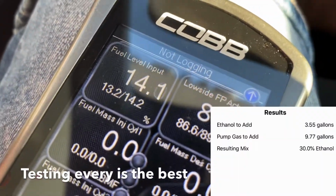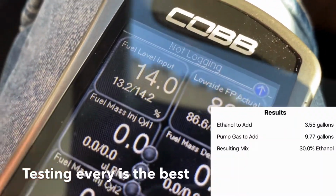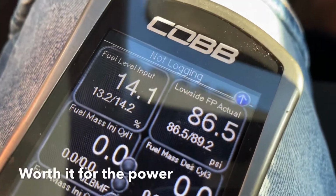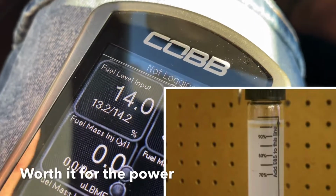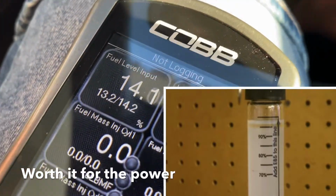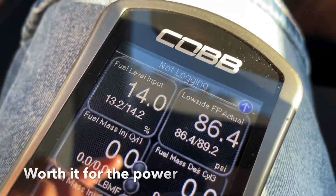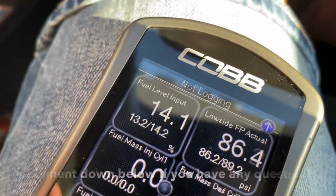You use an E85 test tube. Use any of them from eBay, Amazon, any site, bro. They're all the same. So you're going to put a little bit of water inside and fill the rest up with E85. Shake, and the line will settle, and it'll show you how much E85 you have. It'll have instructions, and it's pretty straightforward.